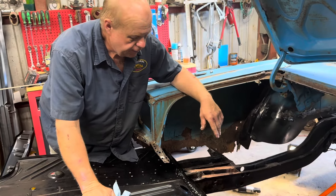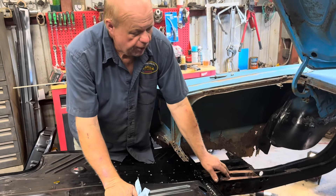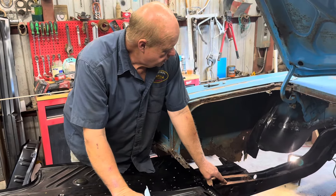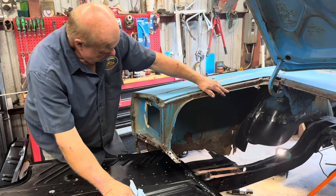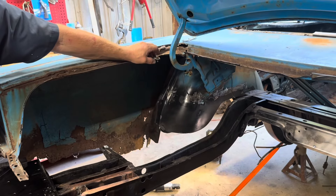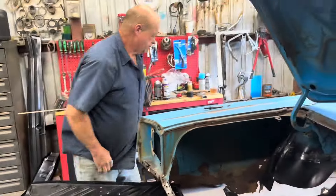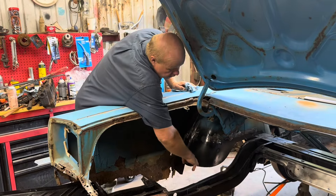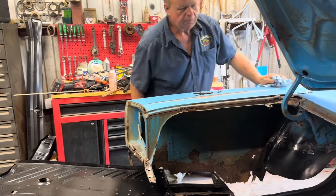I reckon I've got everything done. I've got to clean these tops off here and put some of that weld-through primer on so I can weld it on there. I got to put my cross brace in right here next. I got these pieces here fixed — all that rust I got cut out, put some new metal in there. Actually it looks pretty decent for my first time. I think it'll clean up real nice when I get done. I'm really pushing to punch some holes in around here so I can weld to this slit right here.